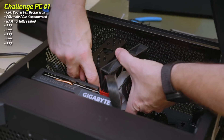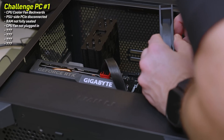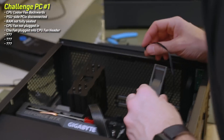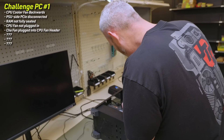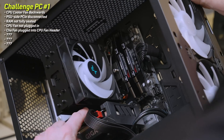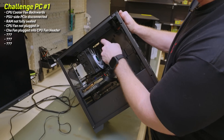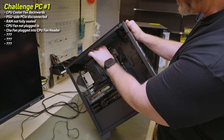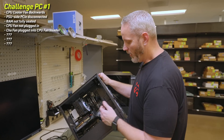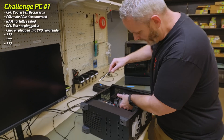I need to take care of the CPU fan first. They have something plugged into the CPU fan header that's not the CPU fan, so I'm going to switch it. There's not a lot of headers on this motherboard — that's part of the problem. I flipped this fan around — it's a little crooked but that's an easy fix. One of the front case fans was plugged into the CPU header, so I'm moving it back to a chassis header and leaving the CPU fan plugged into the CPU header so it can go up and down with PWM load.